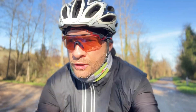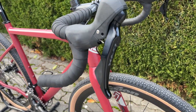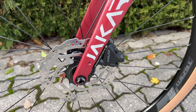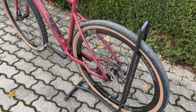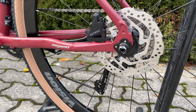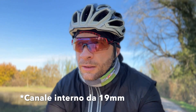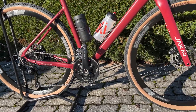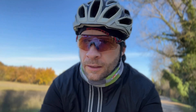This bike is equipped with a Shimano GRX groupset that is truly perfect — it's a mix of GRX 600 and 400. Disc brakes with 160mm rotors front and rear, and it brakes really well. It's been fitted with Vision wheels with a fairly narrow internal channel of 19mm — usually I'd go more towards 21, 22, 23, up to 25mm. We'll see how they perform, and we've already confirmed that a tire swap is necessary.